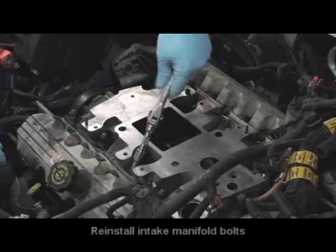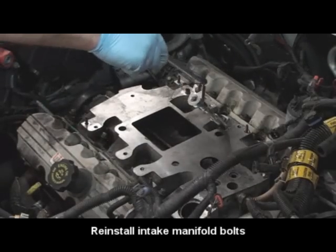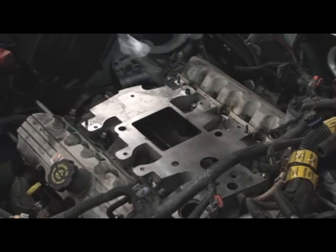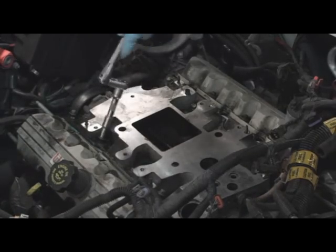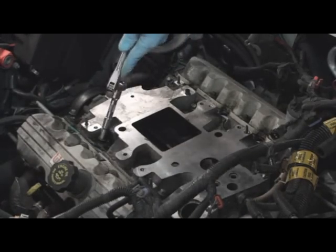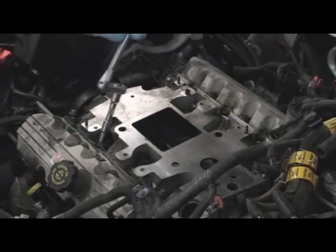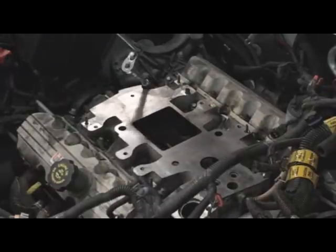Now these bolts, you don't send all the way down to 11 foot-pounds right off the bat. You just work your way there. So it smushes out the RTV and the rubber. You know, just basically let it bottom out. Like that's the first one I did, and when I get back around to it, you'll notice that it still goes down even more. I basically seated it on the intake manifold, but as you go around and do more and more bolts, it starts squishing down.